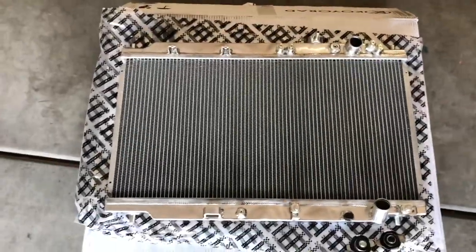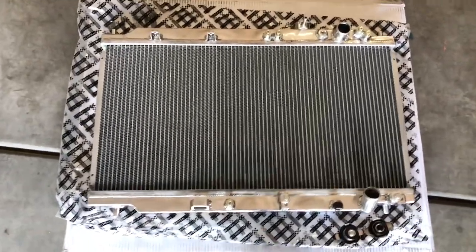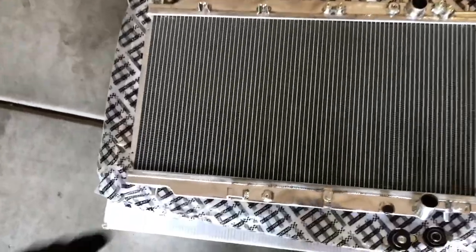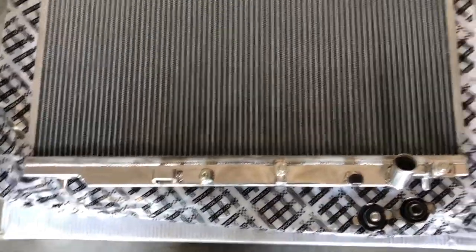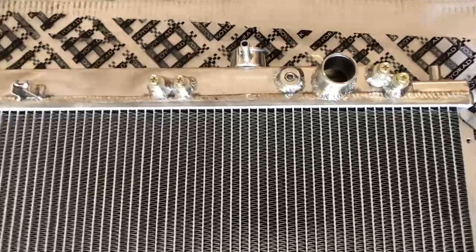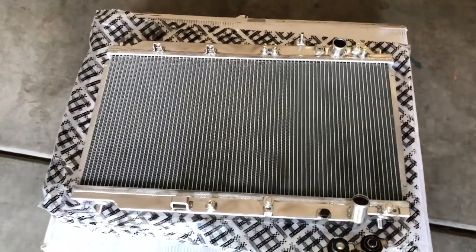There are several reasons that I chose the Koyo radiator over other ones. The runner-up was a CSF radiator and I think that one did come with a radiator cap. I didn't want to get Megan, Skunk2, or Mishimoto — one of the reasons was that they didn't have provisions for the other cooling fan. This is a 1/4 NPT threaded bung for cooling temp sensors, aftermarket, and honestly you can't go wrong with the Koyo radiator. They are proven to be great radiators, but these things are not cheap. The buy-once-cry-once mentality definitely applies — if you buy one of those other radiators you're going to have to modify things, spend a lot more money up front to get it going, like fan shroud, cooling fans and all that stuff.